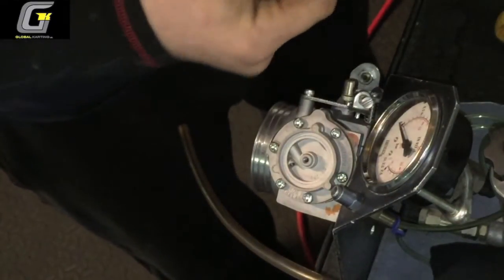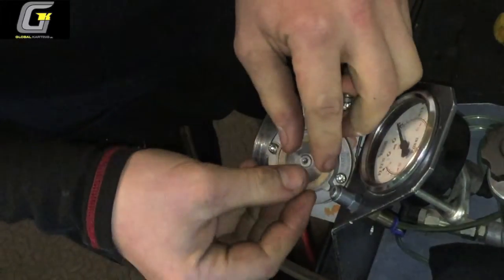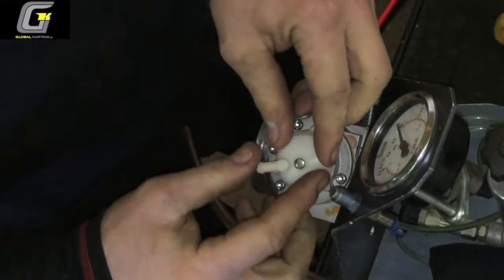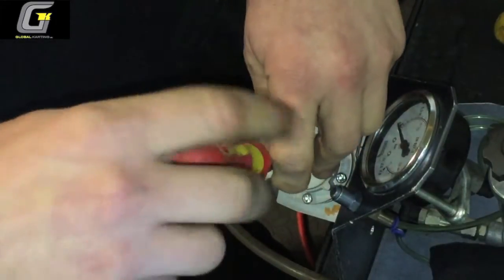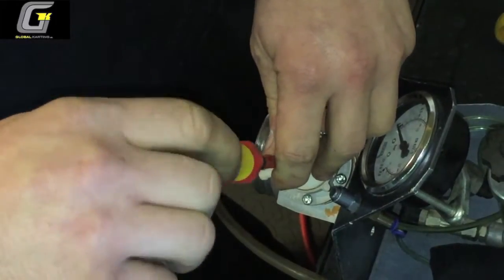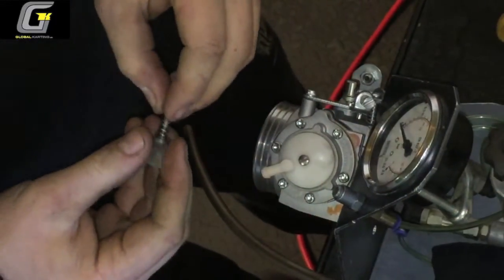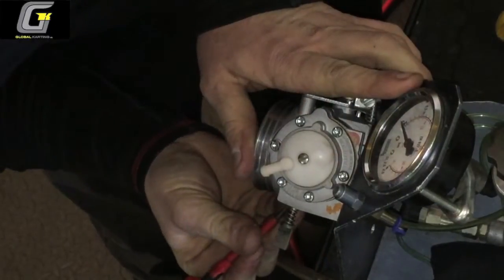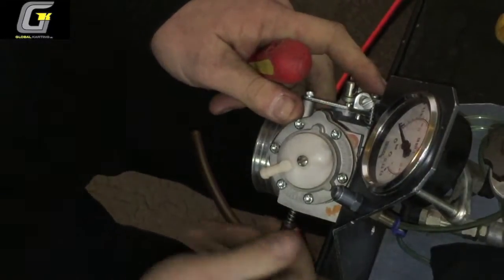Do your filter first, then the cork gasket, and then just your plastic carb top. A lot of people over-tighten these and they just distort and leak pressure — this literally just needs to be finger tight, that's as tight as it needs to be. Then your main jet — just make sure the o-ring seats properly as you're putting the jet in, it goes into the groove. If that's leaking, you won't be able to get your jet set right at all.